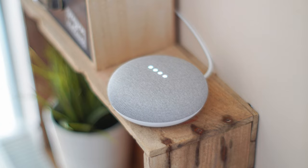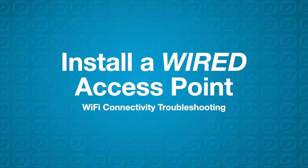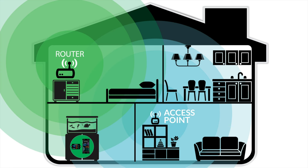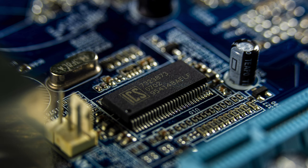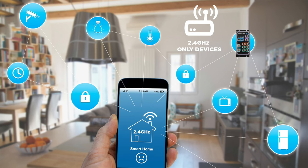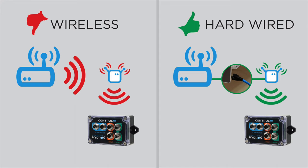Splitting the bands with unique SSIDs disables band steering. If you have a Wi-Fi mesh where permanently splitting the bands is not possible, then we recommend installing a wired access point. Adding a wired access point allows you to bring a stronger Wi-Fi signal closer to your aquarium. It ensures only one fully compatible 2.4 GHz Wi-Fi band, and often enjoys better hardware quality than the standard router provided by the internet company. It creates an isolated network for aquarium equipment and prevents other home devices from overloading the Wi-Fi. Since the access point is connected to the router via wire, it ensures high connection reliability.